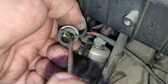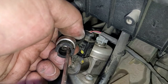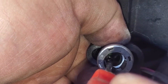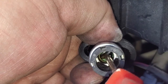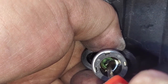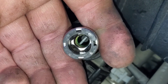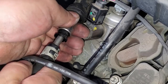In most common cases, the green, white, brown, and yellow o-rings are generally made of a material called Viton, which is fuel compatible. As you can already tell, this is not exactly the easiest task — you will fight with this o-ring, which is why it's important you do not have a sharp edge. My pick has a dulled point so it's not damaging the o-ring; I'm simply trying to roll it into its spot. Here's a view of the o-ring in its place — just be patient and it'll fall into place.